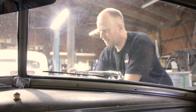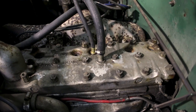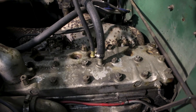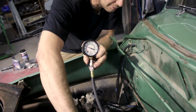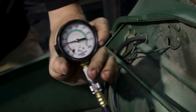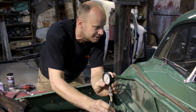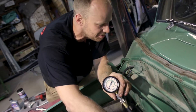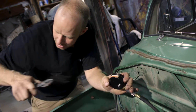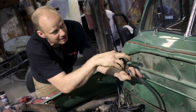We've got 80 pounds on the first cylinder, then 90 on the next. I don't think we have to pull the head — usually if it's a head gasket issue, the drop is between two adjacent cylinders. Number one is down 10 PSI but I don't think that's the problem. We'll throw the plugs back in again. Can you check the owner's manual to see what the spark plug gap should be set at?